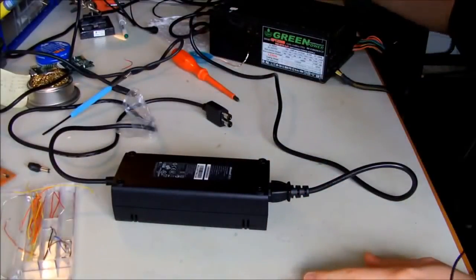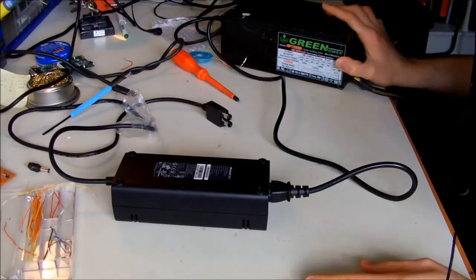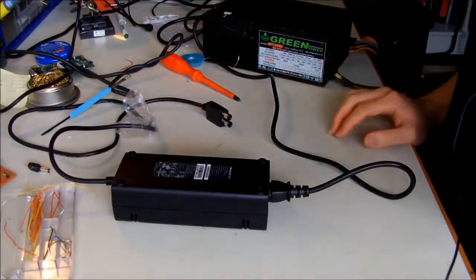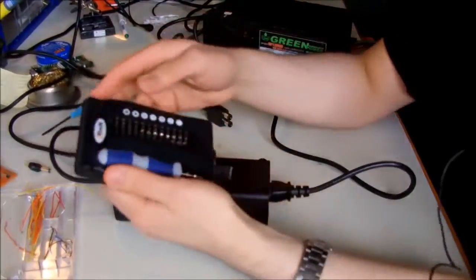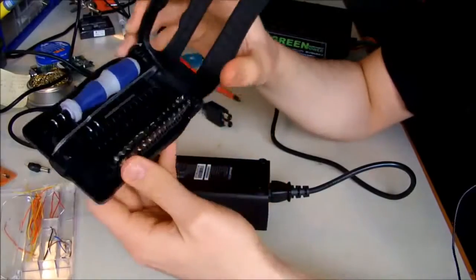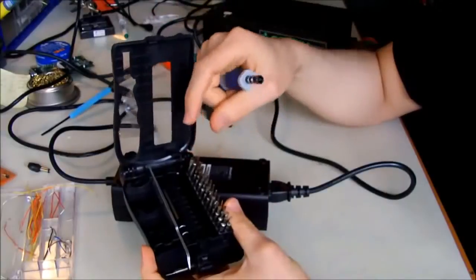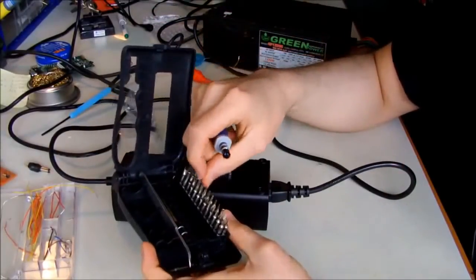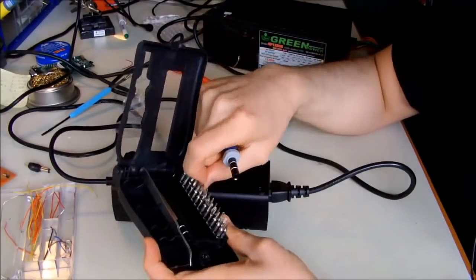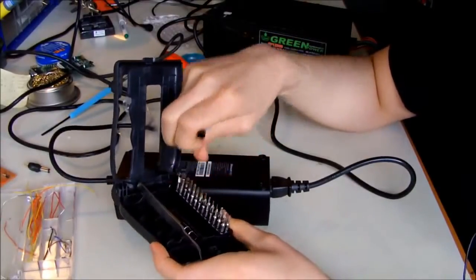And if you remember, what you have to do is use a TX8 screwdriver, a Torx 8 security bit, and I have to find it first. So as I told you, you need a TX8 screwdriver. I really recommend you getting one of these screw kits. It's very useful. You can open everything with them, including your Xbox, your iPhone, iPad, iOS, Mac, almost everything. So for this one I'm going to use the TX8 bit. Okay, if I can take it out.